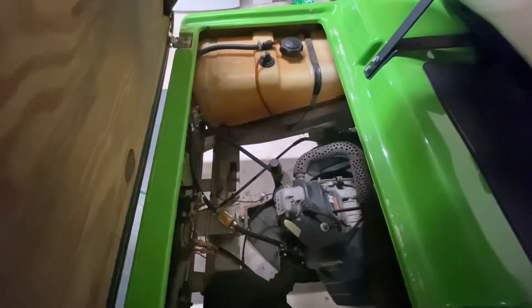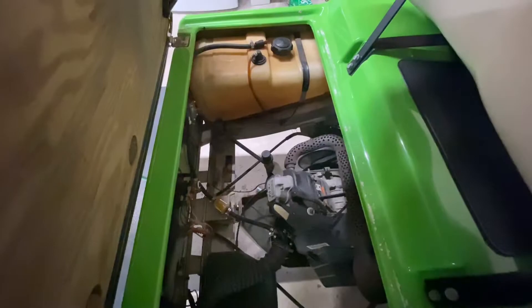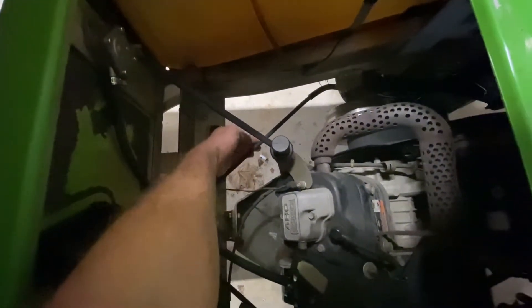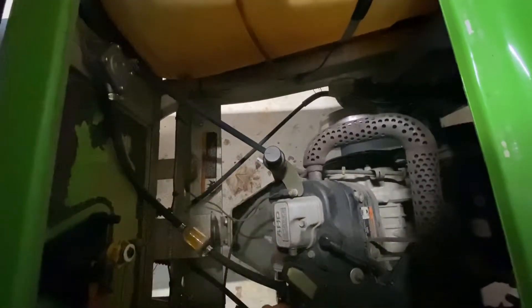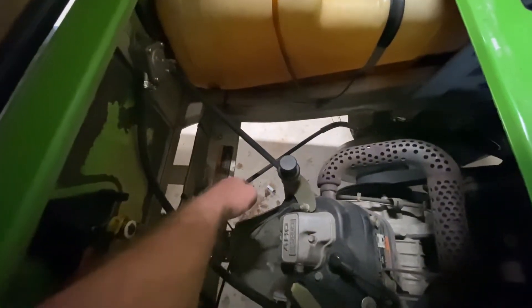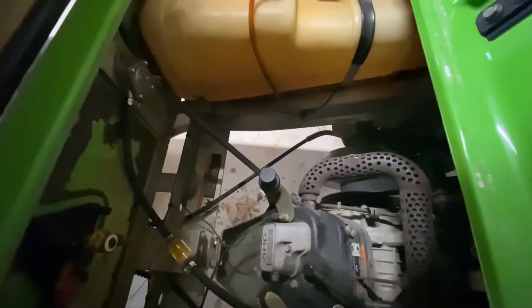So I have some new fuel line, I'm going to go ahead and replace that — that's an easy fix. The second side effect is the same concept with my brake line. This brake line is pretty banjo string as well. Fortunately, there's only a small little metal clip that holds these brake lines in place. So we can go ahead and replace that clip, get a little bit more slack into these brake lines so they're not digging in so hard.